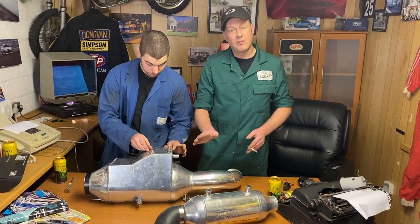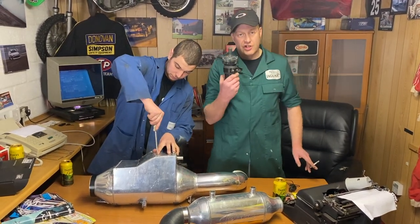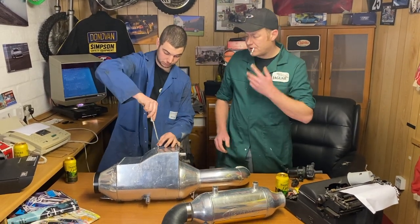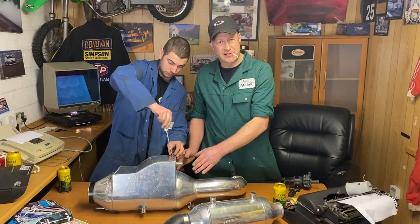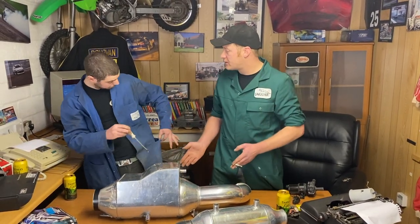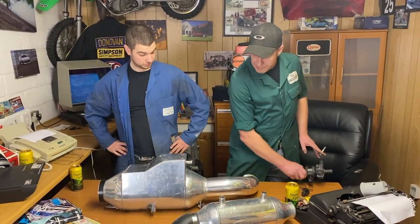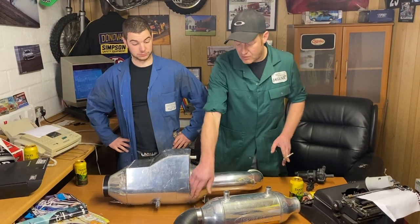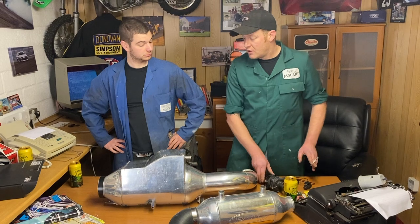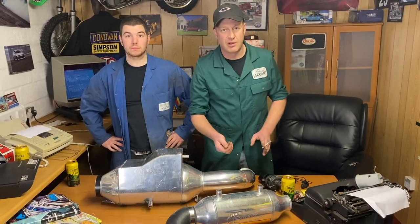Not only that, like I said, when we go drag racing, what we'll probably do is shut the pump down on the ECU and just fill it with ice. Keep it cool. It's only got to do a quarter of a mile. But when we do some drifting, some circuit racing, some hill climbs, all that kind of stuff, we can then activate the pump. We put gauze in one of the outlets so it doesn't hurt the pump. It'd basically be slush. We'll chuck the ice in, fill it up with water, turn the pump on.